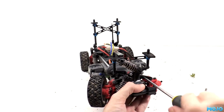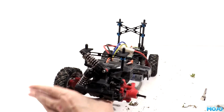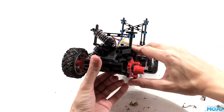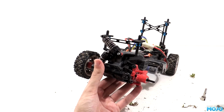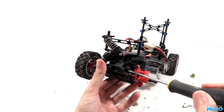One little issue that shows up now, the drive shaft appears to be just ever so slightly too long. When you compress the suspension more than a little, there's a small amount of resistance, like a spring. What's happening is as the suspension goes up, the drive shaft moves in the inner drive cup and is compressing the O-ring quite a bit.